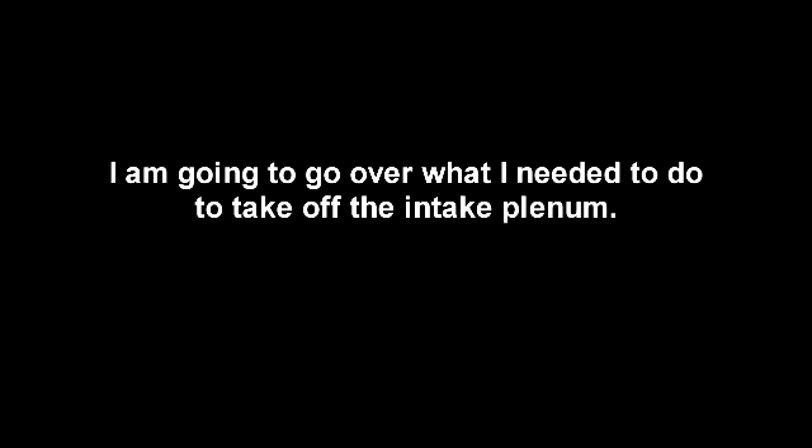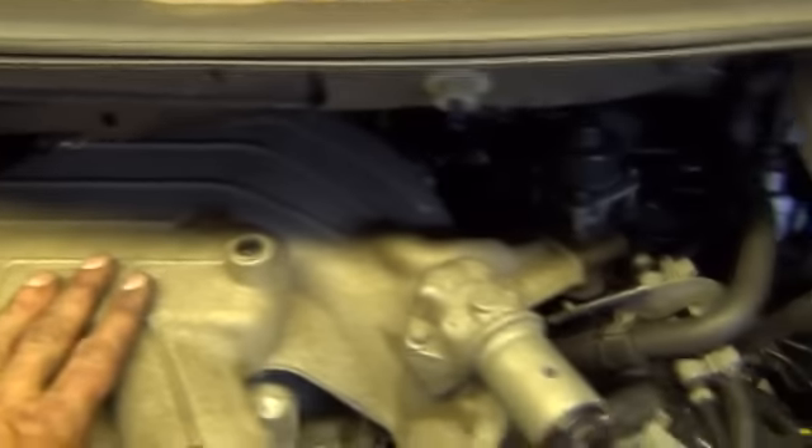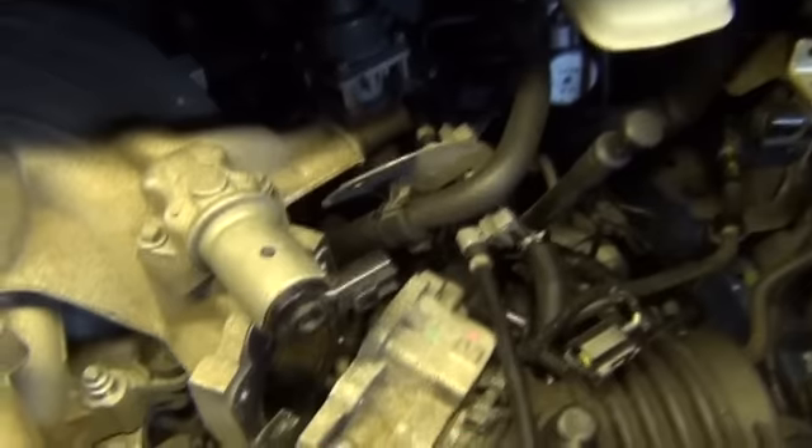Here's the new hose location — there's that clamp, it's going to attach right there onto the PCV valve. Minus the surrounding hoses and whatnot, the intake plenum comes off with these four, five, and six bolts. Moving this hose out of the way, there's another hose behind there, another hose here, and another couple hoses down here along with all the wiring to pop that plenum off.